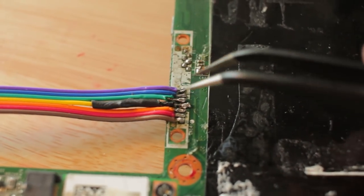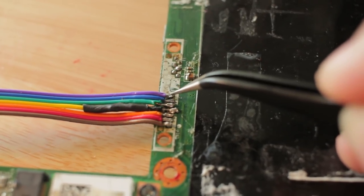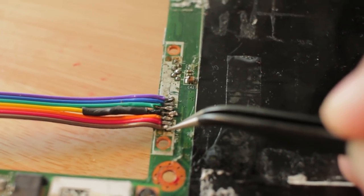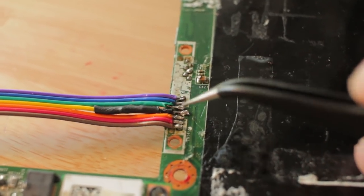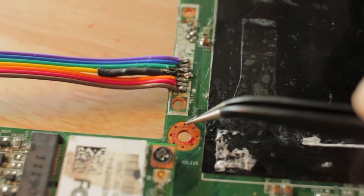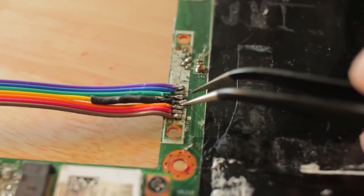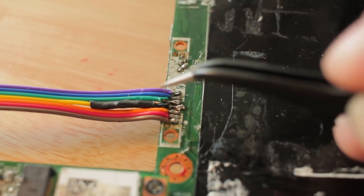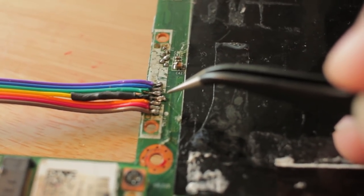Crap that I had to deal with. This is essentially a ground wire, and I could just solder it to this pin or this pin over here. I could have run the wire to either this side or this side. I could run it to this post, I could just run it straight to here, but I want to do it right. And I had to clean everything up over in this area, scrape the surface again,